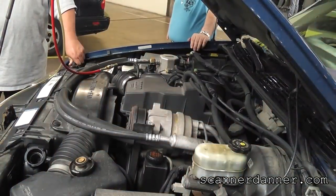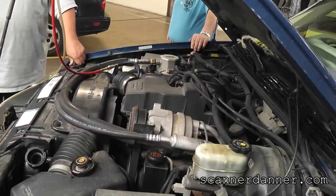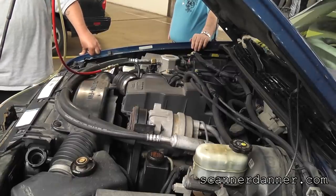There are no fault codes. Fuel trims are completely normal. The owner says it runs perfect, other than a long crank time - that's the only problem we have. Now we are losing coolant and we're adding coolant, so that symptom is there. No white smoke. Let's see if we can catch the long crank time.